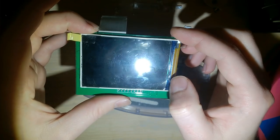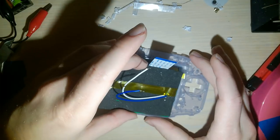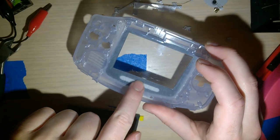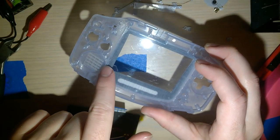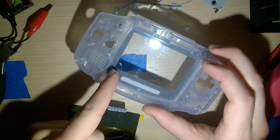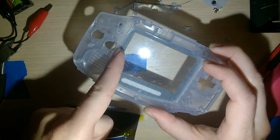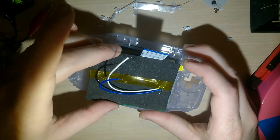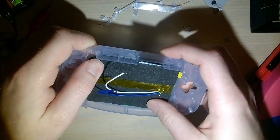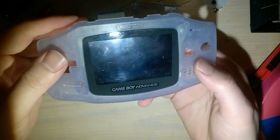There's as much extra display as there is board here. But anyway, if you didn't follow that, it's not too important. Just basically cut it like an AGS-101 mod and then completely annihilate this left wall here, and anything else that might get in the way, all the way up to the B button. But once you get that, notice this thing drops right in. Perfectly flat, it's not seesawing around on anything. Looks pretty good in there.